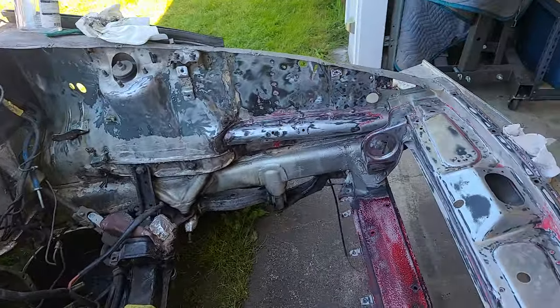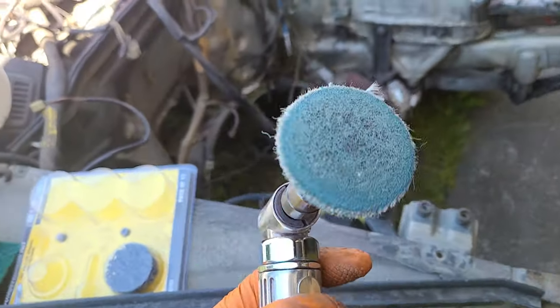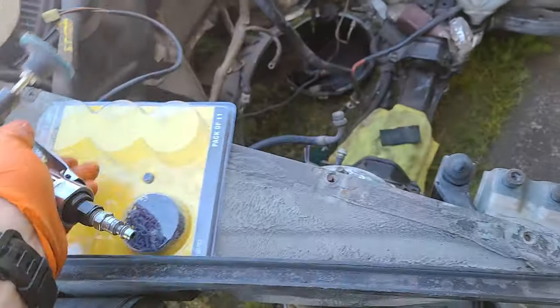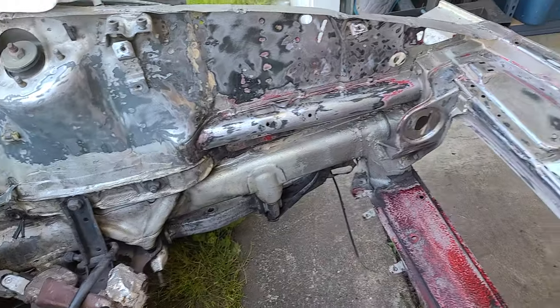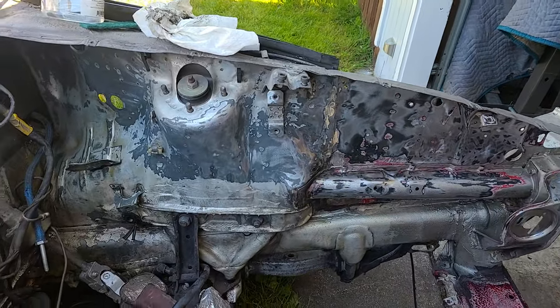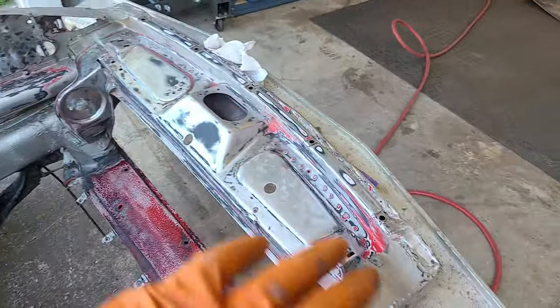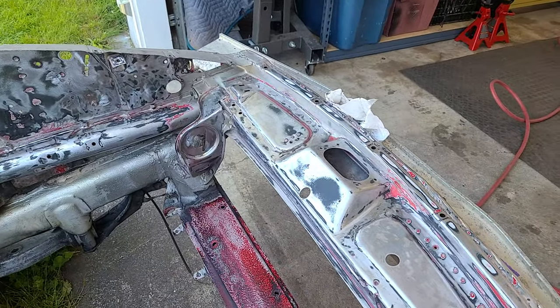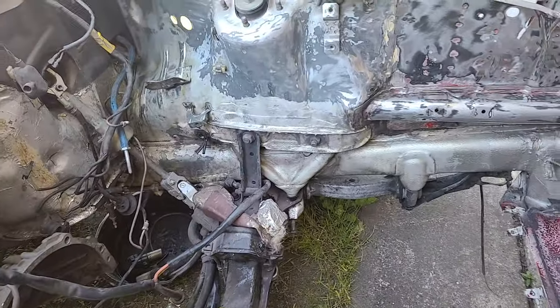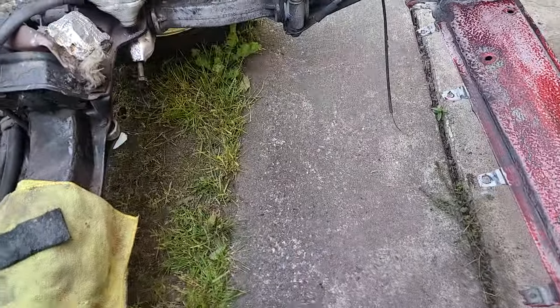Alright everybody, so I moved the Porsche outside so I could work on it a little bit easier and keep the shop a little bit cleaner. What I ended up using was one of these guys with a various number of different tips on it. I got a lot of this taken down to bare metal — I figured it would be better to go as much bare metal as I could. Then I'll hit the rest of it with just a piece of sandpaper real quick. I'll probably do one side in primer today, maybe get the upper half of the core here in primer as well. There are a lot of things to tape off and move, like this bracket that pivots out of the way — it's a two-piece bracket I can take out to get a little paint behind it.